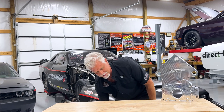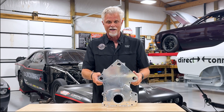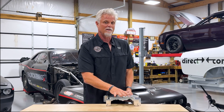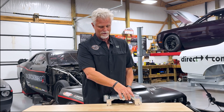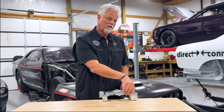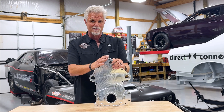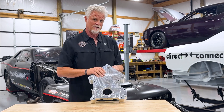This front cover was designed to be much more effective for a lot more people, including the growing number of turbocharged cars. In this front cover design, we've used the front pan rail for the 6.4, 5.7, and 6.1 engines. It does not use the Hellcat front cover pan rail, which pushes it back further to allow room for blower drive pulleys. Guys with turbos don't need blower drives, and centrifugals often don't either. So we don't need that extra room. This cover uses the more common 5.7, 6.1, and 6.4 bolt front-end pattern for those style pans, as opposed to the Hellcat. When we go to the supercharged front covers, we switch to the Hellcat pan rail for room for that extra pulley on the bottom.